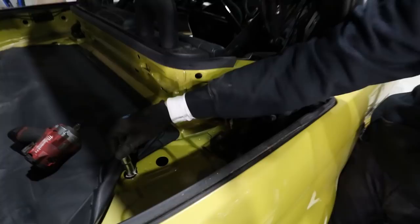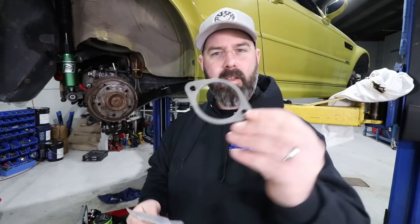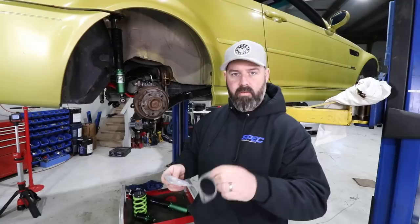Time to finish off our Fortune Auto setup. I have a small confession to make. These are the Bimmerworld rear shock tower reinforcement plates, and they're designed to go on the top side of the sheet metal. But with the convertible, or Cabriolet, there's no access point to put this down on top of the shock without cutting a hole in the sheet metal. We decided we'd rather not do that — we inspected it and it looked fine, no cracking up there. So these work on a coupe or any E46 that isn't a Cabriolet, and we'll save these for a rainy day.